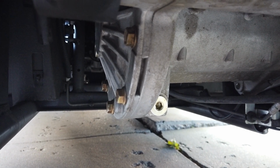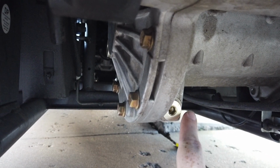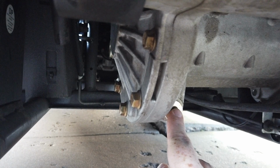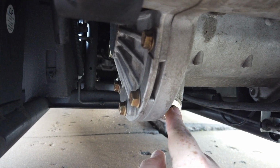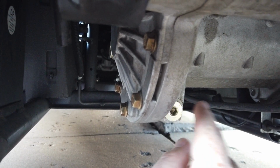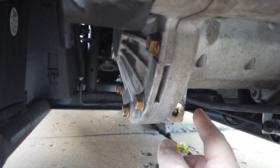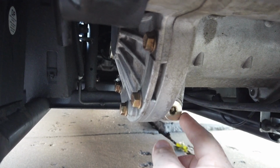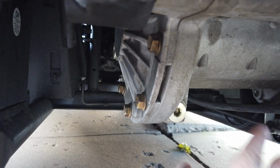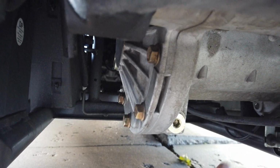So one of the lessons that we learned as I was doing this was, once it drains completely on a flat surface, you're going to put this plug back in. Now, understand that you're looking at 10 to 14 foot-pounds of torque on these, and that is not much. I mean, it's barely over hand tight. So these things are not super tight. Please be careful not to tighten these too much, because you'll mess up the seal, and over-torquing could mess up the housing. So just keep that in mind. 10 to 14 foot-pounds of torque is all you're going to need.